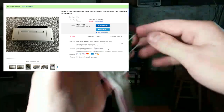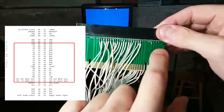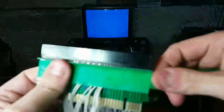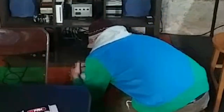This is the cartridge extender I ordered on eBay, and I've soldered about 20 wires to it. I'm going to ignore the expansion pins and I've ignored the first two pins on each side, because amongst them there's the ground and the extra voltage — so I'm not even gonna take any chance. Just put some tape on it — that's how you do it, right? Is it still booting?